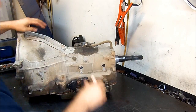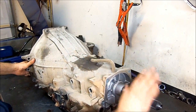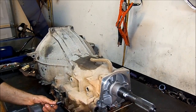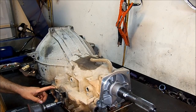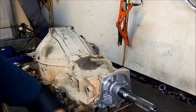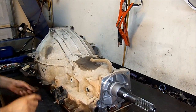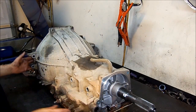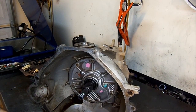The first thing — I'll get this speed sensor out of the way to make it easier for disassembly. I have already taken the 4x4 extension housing off. I'm going to take the manual lever position sensor — in this case it's the digital transmission range sensor, or DTR for short — and remove it. Then I'll go ahead and remove the pump bolts.